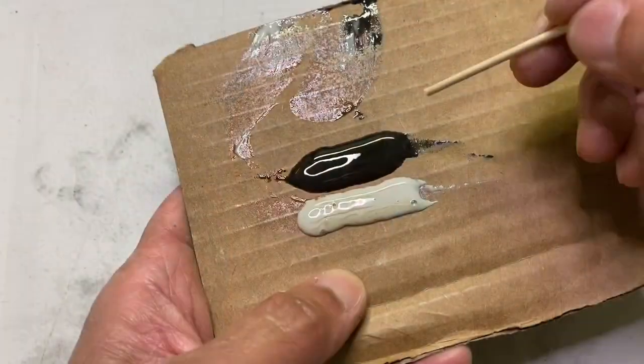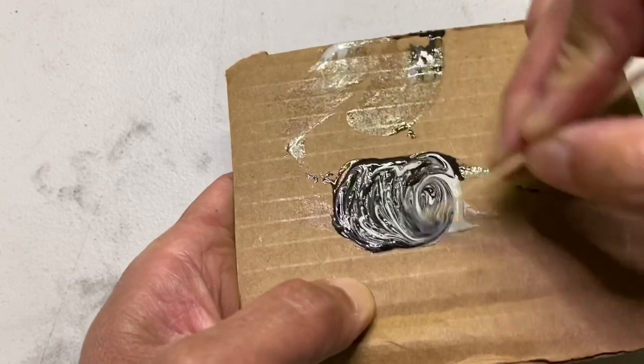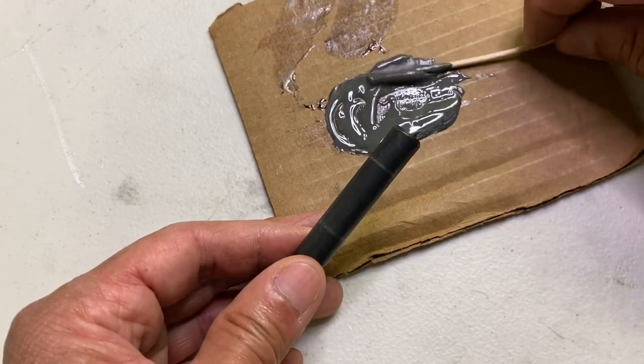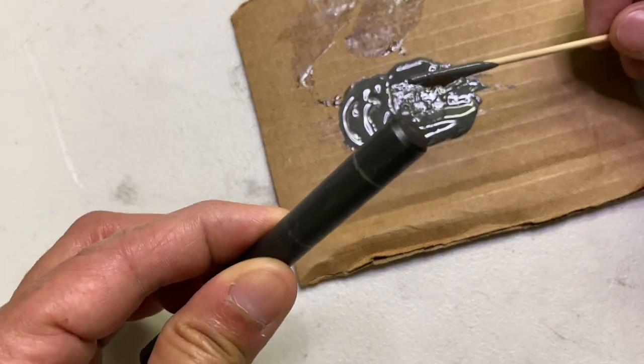Unfortunately, I didn't capture the butter bond of the oil dipstick tube to the block. So what I'm gonna do is a simulated butter bond so that way you guys can understand the concept. My apologies. So lay out two strips of JB Weld and make sure you mix them nicely. I just use a piece of cardboard and I just wanna get a nice consistent color. Butter bonding is a really simple process. All you gotta do is grab some bond on a little stick, and let's just assume that this transfer punch is the oil dipstick tube.